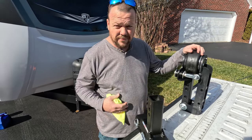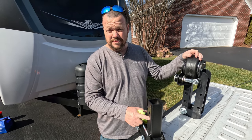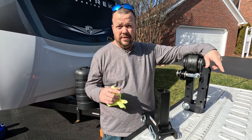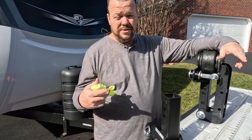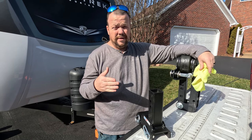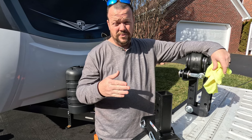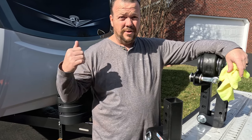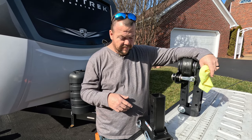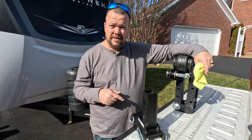One thing I like about this is that the bolt patterns match up with my Fastway hitch. Also, since I have a newer three-quarter ton truck, I could order the two-and-a-half inch stem for the receiver and hopefully take some of that slop out. When you run a two-inch with an adapter to your bigger hitch, you get a little bit of slop. Over 25 to 30 feet of trailer, that translates into a lot of left-right movement.